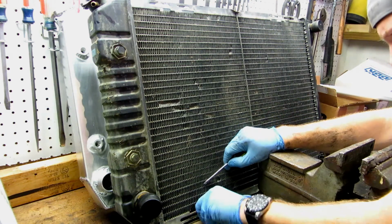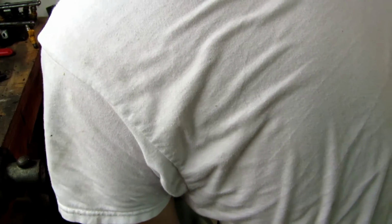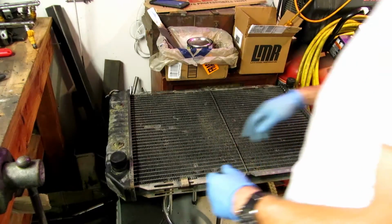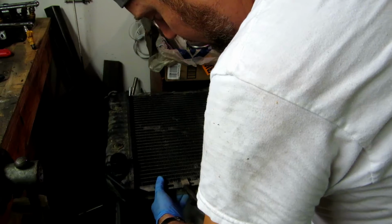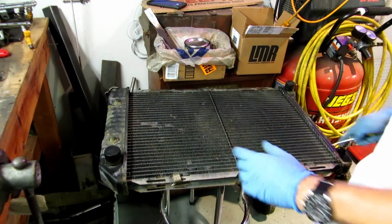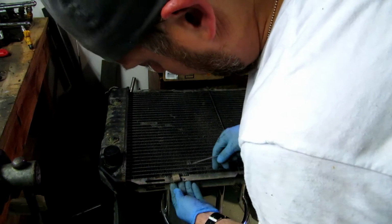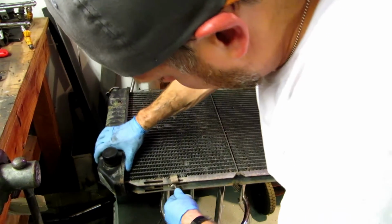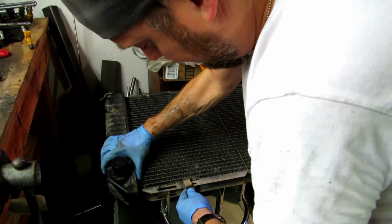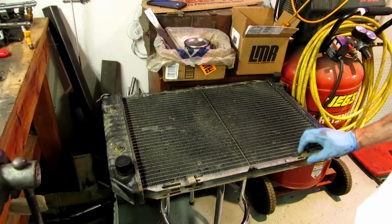And don't forget your bottom clips here, guys. So putting these caps on obviously made a big difference in spillage. Put all your caps back on, you won't have a problem with it leaking all over the place when you're trying to work on it. Let's get a little persuasion with the hammer here. Okay, so there's a proper method of releasing these. Of course, I've never done this before, so learning with you here. This groove right here, the back clip actually clips into, so what you want to do is put a flathead screwdriver, hold down on it, and that will release it. Let me get a bigger screwdriver, but that will release it, and this one's been released.